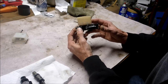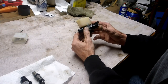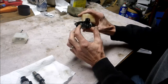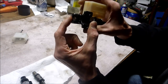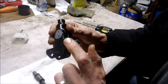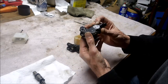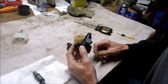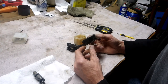So it turned out that the master cylinder on the '96 was bad, and my spare was bad also. I took the brake lever off and the piston is not going all the way out like it should. I did have a third one but it turned out this piece is broken off where it bolts onto the handlebar. You don't have to take it apart this far — I just did because I've never taken one of these apart before, and once I realized how easy it was I had to shoot a video on it.